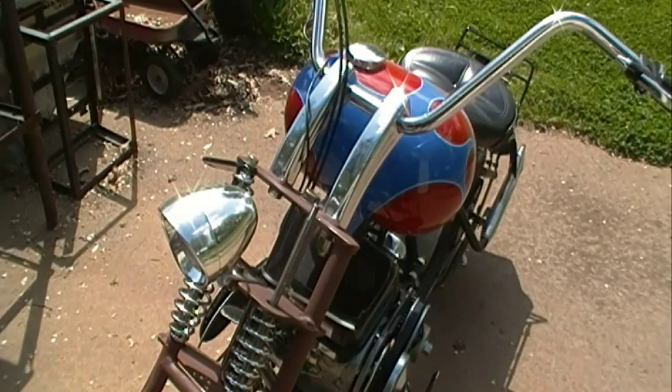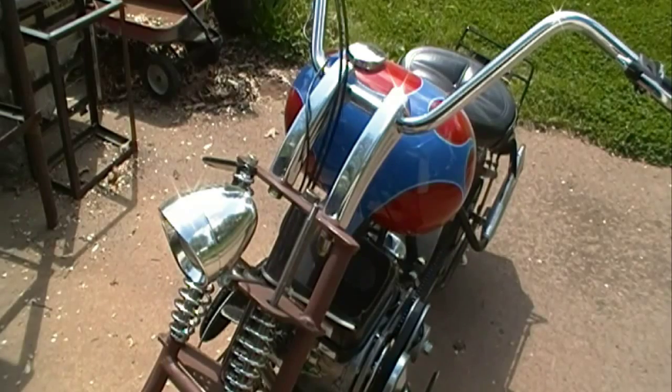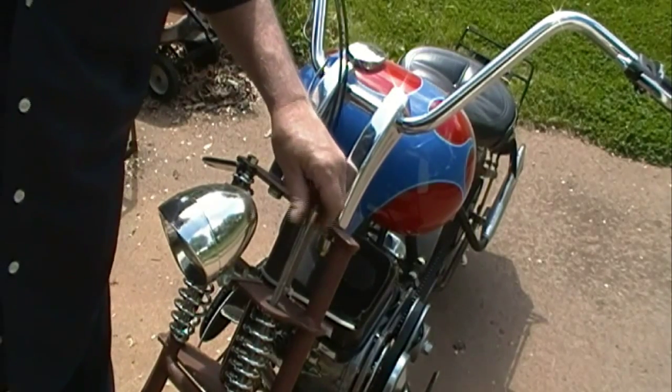Anyway, I can take them to work. You can put them in the lathe, cut that out of there. It'll be true and correct. I'll have him cut it out to 3.985. Give myself a half of a thousandth clearance, and it should slide right down in there.